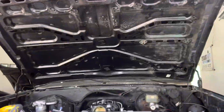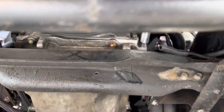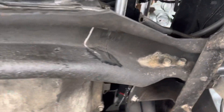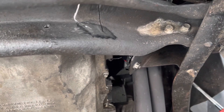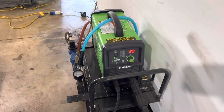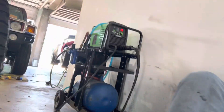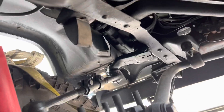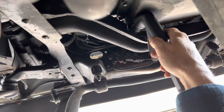Let me come down and show you. I've already started making cuts with the Sawzall — that's the best I can get it — and then I've cleaned the paint off from the frame to make it easier to cut. From here I'll make a couple of really nice cuts with our plasma cutter, take that little piece out of the frame, and then we'll weld a little brace in from the bottom.